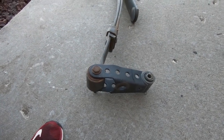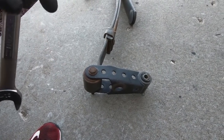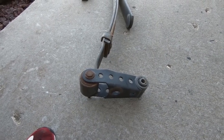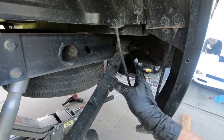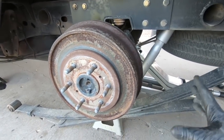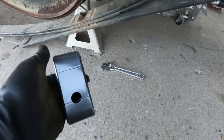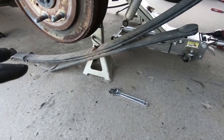Before I slide the leaf spring back into place I'm going to replace the rear shackles — he bought a different set. This is just 21 millimeter, I'll slide the new ones on, basically in and out. I'm not going to snug these down with the impact — I'll take them apart with the impact but leave them kind of loose because we're going to torque all this once the weight of the truck is sitting on the suspension. Then we can move the leaf springs under the truck and start reassembling. I always like to put the rear of the leaf spring in first — it gives me more mobility. Now they've made the hole in the center of the saddle a lot bigger so you don't have to reverse the center pin anymore, which is really nice.